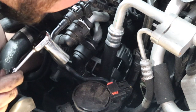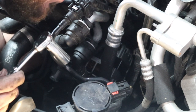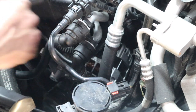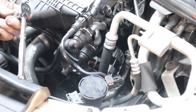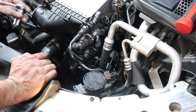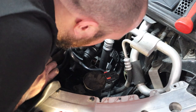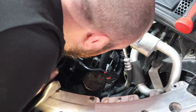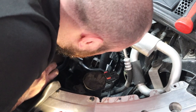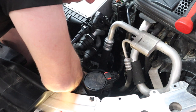Arm between the engine and the alternator, reach around, put the nut on with your left hand, get it as far as you can. It's a nylon lock nut, so you're not going to be able to get it very far — righty tighty, lefty loosey. You're going to take this ratchet in your hand like this and serve it behind the alternator right where you put that nut. You're going to come across here and onto your nut from behind. You might need to finagle it a little in order to get your ratchet on the bolt.